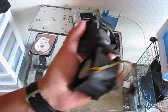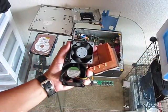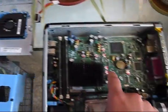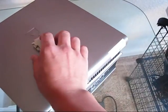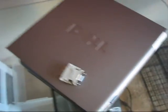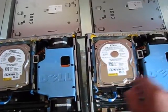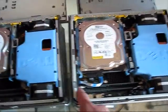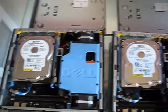All heat sinks and fans — no dust. This one is almost assembled, RAM and everything. The new thermal compound will be applied. I recently received more units which have to be deep cleaned as well — all of them are Dell Optiplex. Dust is actually the number one cause of most equipment failure. It could be desktops or laptops — the same way: units have to be disassembled, RAM modules have to be removed, hard drives, fans — everything has to be deep cleaned and dust free.